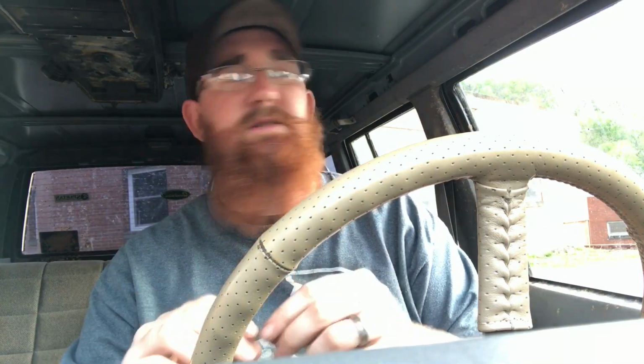Now, when I first got my 5-speed, that thing would overheat sitting in traffic so bad. But I had to flush everything. I even took the radiator out. I flushed it. I flushed every hose. I flushed the heater core. I mean, I made sure I flushed this thing good, put a new thermostat on it. You can't just do a half crap job of flushing something and expect it to cool.